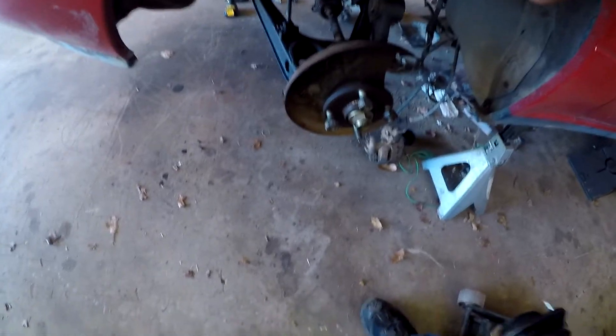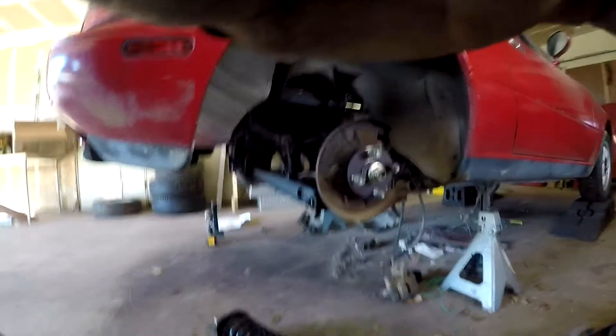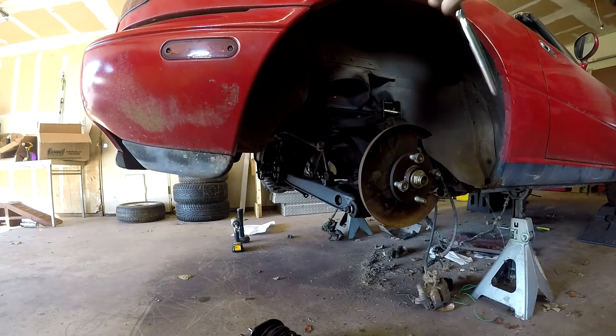Alright, I've got the springs all finally done. When you do it the first time, make sure that this hole lines up with these as well — that way when you're putting them in you don't have to worry about twisting it, they just kind of plop in. We'll take the retaining bolt — the bottom bolt — out real quick. I already got this side done, but yeah they're looking way nicer and stiffer than before. It's very easy when you have this undone because you can put your weight down on it and just sink it down. You can definitely tell the other shocks were just worn out.